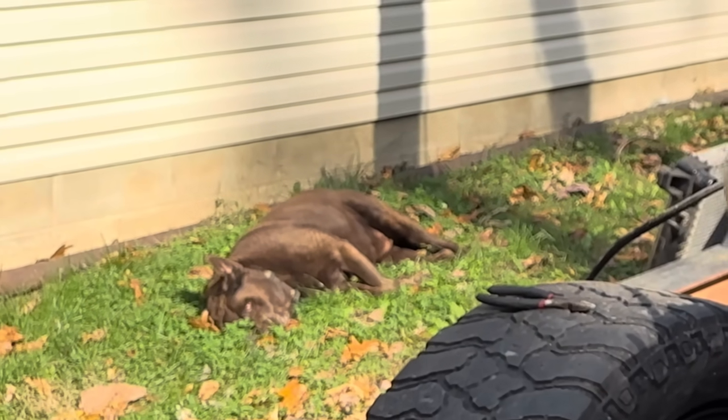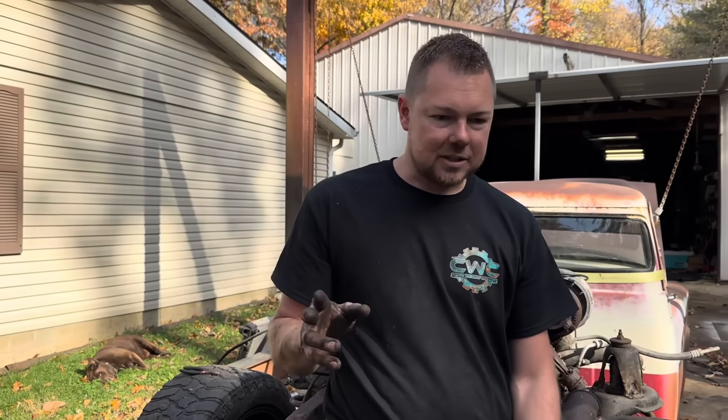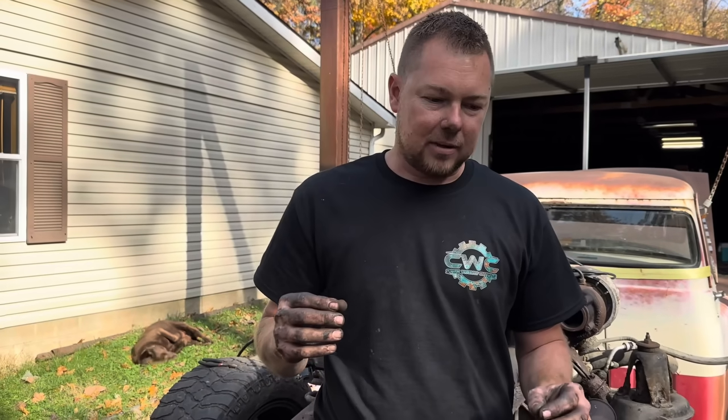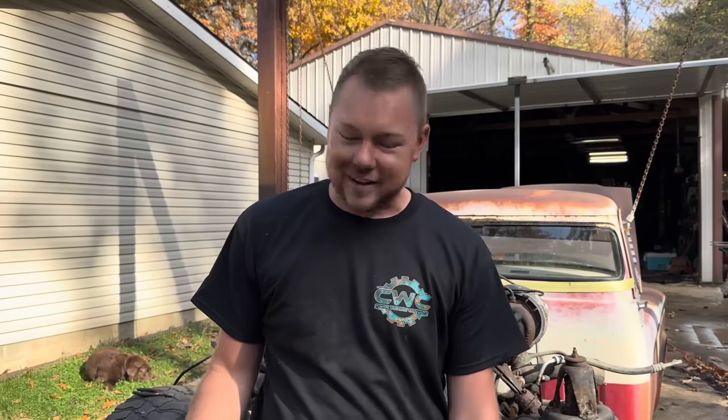Hannah said that earlier. So manual valve body, I know I said this before, I'll say it again. So this is a 47 RE transmission. It shifts hydraulically up to third gear, but it's going to need 12 volts to shift it into overdrive and torque converter lockup. So with the manual valve body, you're still doing the electronics, but it's on the shifter. So you can shift it like it's a manual, but with no clutch, you just bang shift it. So, all right, that's that. We're gonna put this to the side, and that's about it for this video.